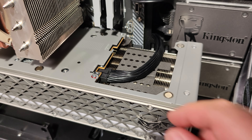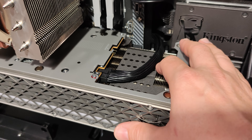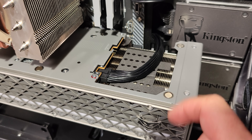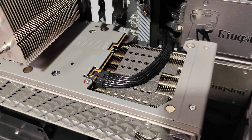Here's a close-up of the cooling situation. This foam pad has tiny holes in it so the cable doesn't rub on the fins and get cut or short-circuited, but you are losing a lot of cooling capacity. This foam is a very good thermal insulator, so it keeps heat on the fins. With those tiny holes, you're looking at maybe 20% cooling efficiency in that area — the air doesn't go through those holes efficiently, so it just heats up more. This whole section makes no technical sense; it's just design.